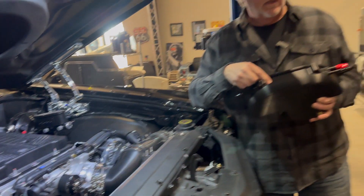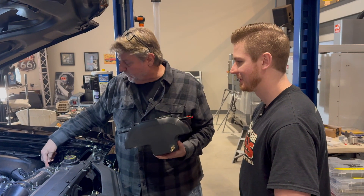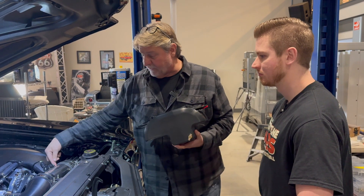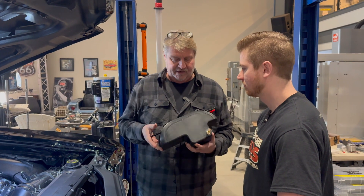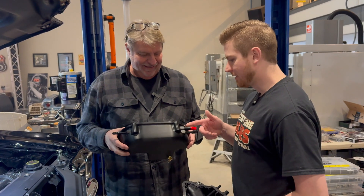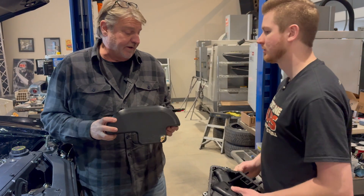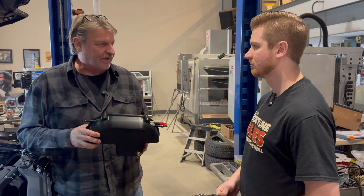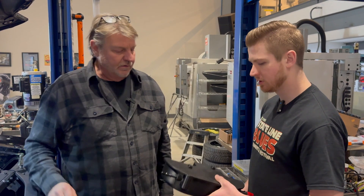I don't want the high vacuum, because off of this port behind the throttle body there's a lot of vacuum — this is where you can run a brake booster from. That's way too much vacuum; this thing would crush — it'd be sucking really hard on it. That's why we're going to put a passive vacuum port either here or here. We'll figure it out as we go. Let's get this thing designed in place and then go to final plumbing. What do you think — split it in half or end here? Use your better judgment on design, material, and print time.